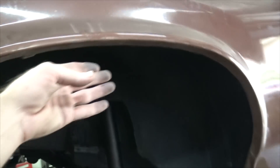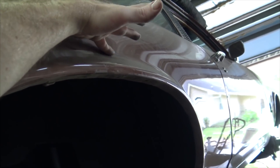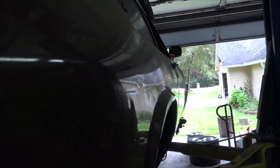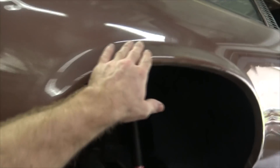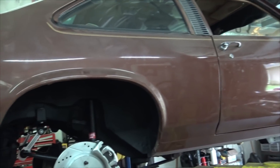I can get the custom offsets if I need to, mess around with tire sizes, and roll the wheel well. The only thing I worry about on the wheel well is it actually comes out quite a bit right here, and then it has like this massive inch-and-a-half lip that we can trim or roll. But the problem is you only get like two, maybe three inches before it's right back into the body. To get that out a little bit, we'd actually have to push the bodywork out to roll that fender. I'm not sure how well that would work. So all kinds of problems and we're going to sort through some of them - maybe.